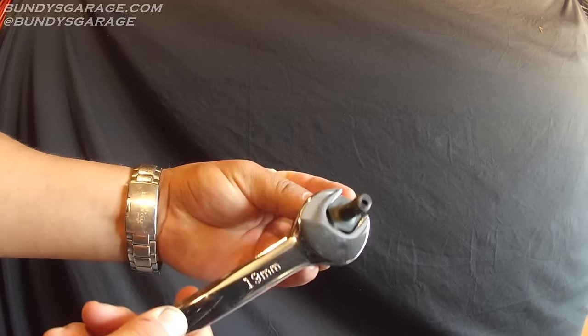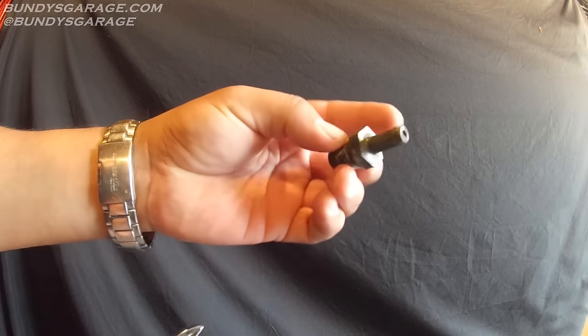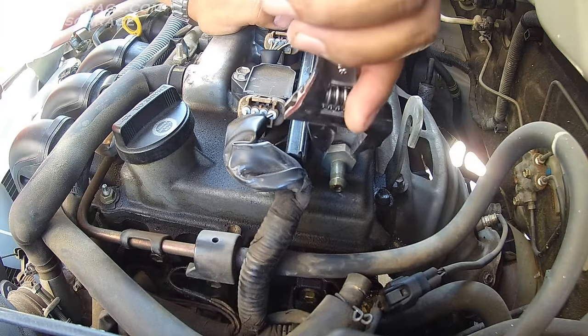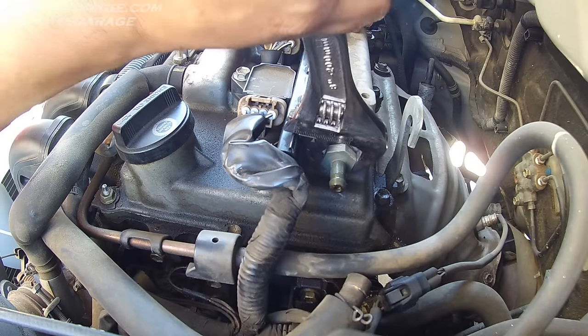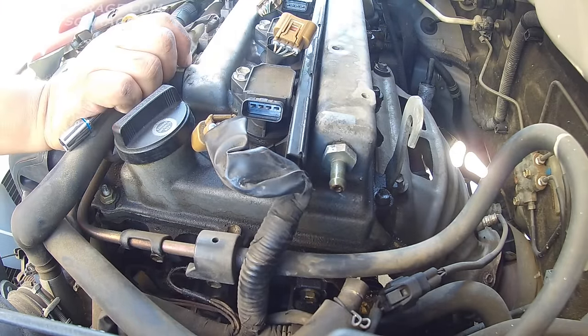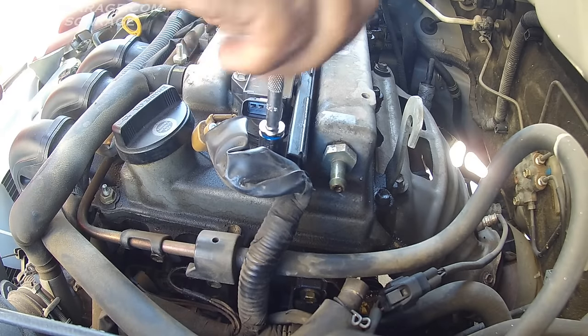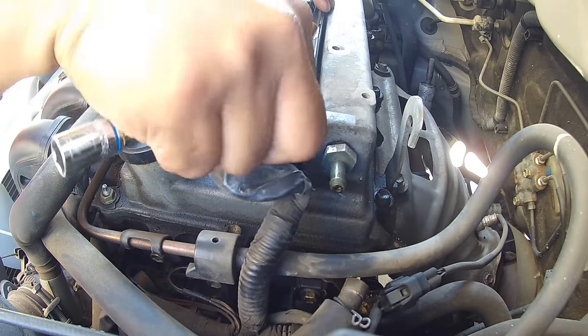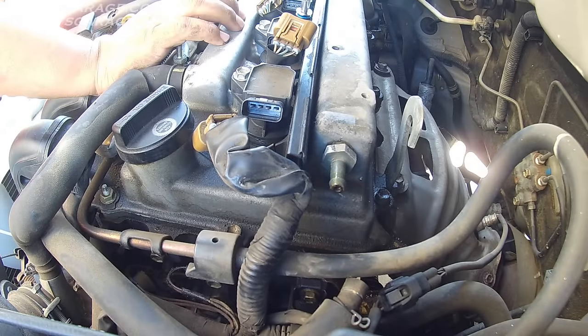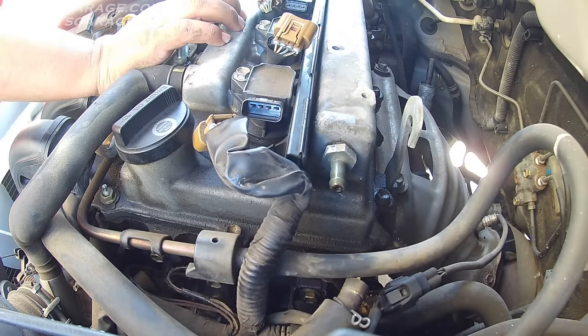If you don't want to use a crescent wrench — a 19mm wrench fits right into place to get the PCV valve out. To give myself a little bit more room, there's a plastic rail right here that holds the wiring harness loom for the spark plug coil packs. To get in there a little bit better, I'm going to move this out of the way. There's one 10mm nut and one 10mm bolt holding this on. I had to remove some of the clips for the spark plug coil packs — if you want to see how to remove those, I'll put a link in the description. I'll show you how to do the spark plugs on this particular engine.